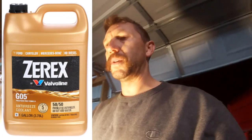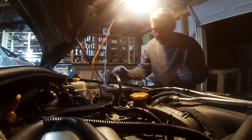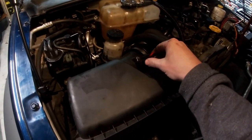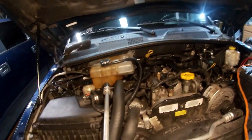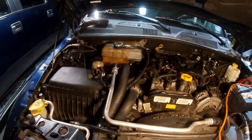I think that's getting close to buttoning it up. Got to fill up the coolant and I'll probably run it for a little bit, check lights, things like that, and then do an oil change. I got fresh new coolant. Air box in, air filter in, clipped down. Now I just need to attach my sensors — that one's in, okay, buttoned up. Coolant. I think we're ready to start and check for coolant leaks — which of course we will not have any. Dear lord, please don't have any leaks.